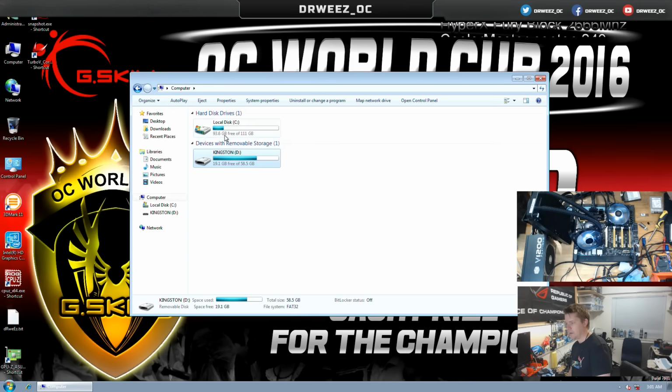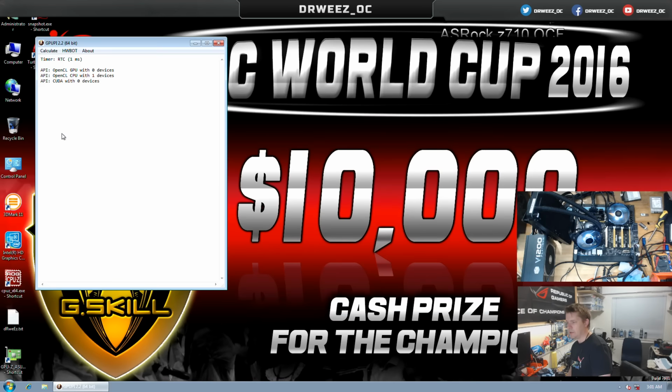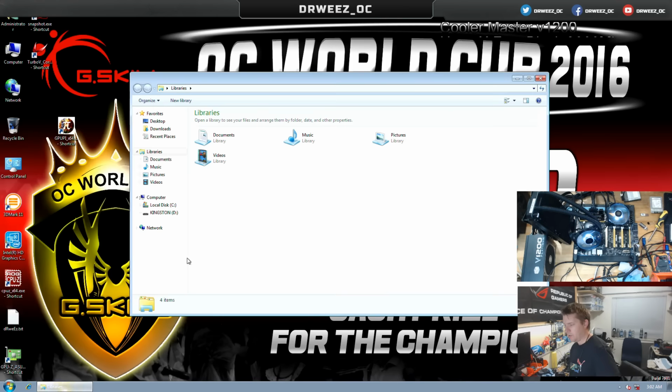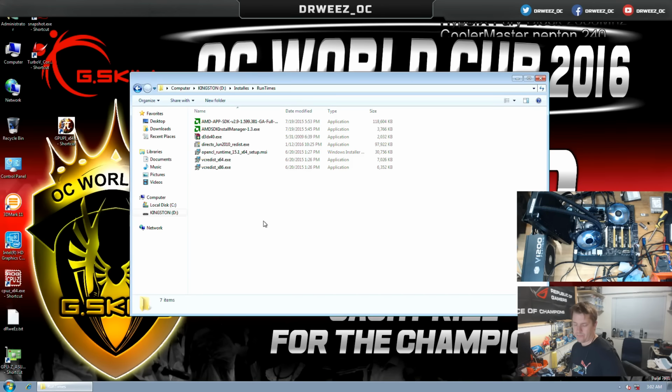Okay, so it's not there, it must be here. Then GPUPi. So I should already have it here. Yeah, so you've got a 64-bit and obviously a 32-bit version of it. And I should imagine that the 64-bit version is the way to go. GPUPi basically relies on calculating instances of Pi using your processor or your video card. So here is DrWeez's pro tip number one with GPUPi: there are some runtimes that you need to install in order to have the right libraries on the PC that enable you to use the right command set to calculate.